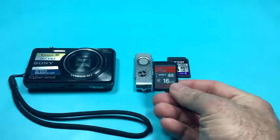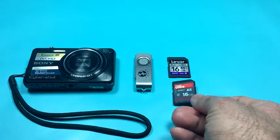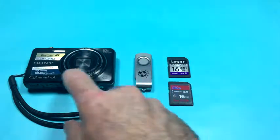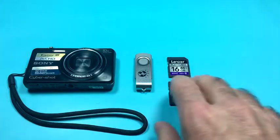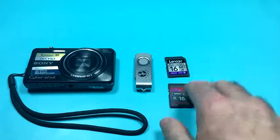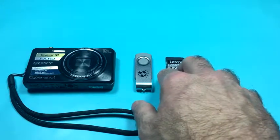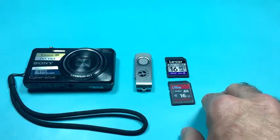I'm going to format this memory card in order to clean it out, and I won't be doing a quick format — I'll be doing a full format to make sure it's as clean as possible before I execute the recovery process. That's what I'd recommend you do as well. Use a spare memory card if you can, because it's always better to test without your normal memory card. If you can't, that's okay too — you can use your everyday memory card or a USB stick, whatever makes sense for you.